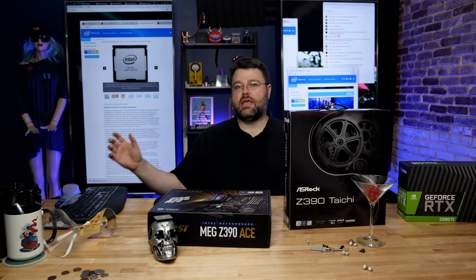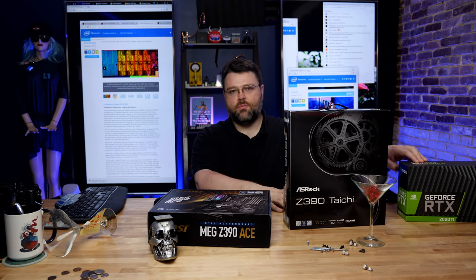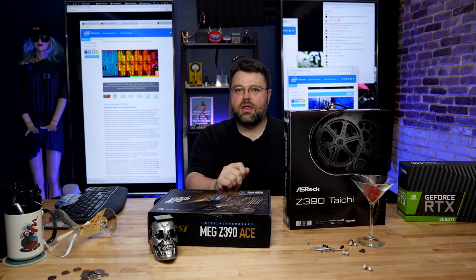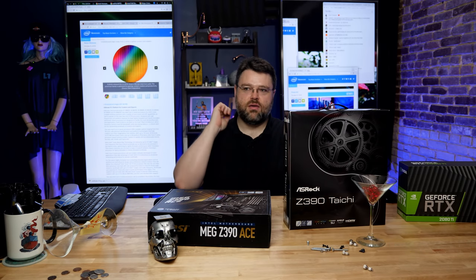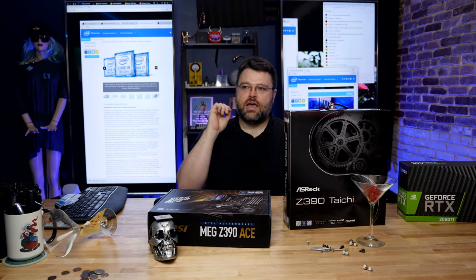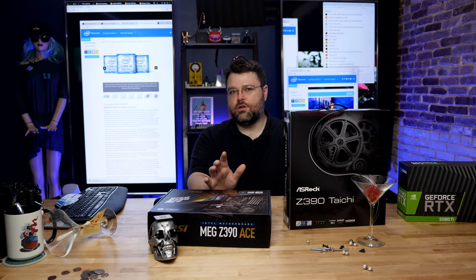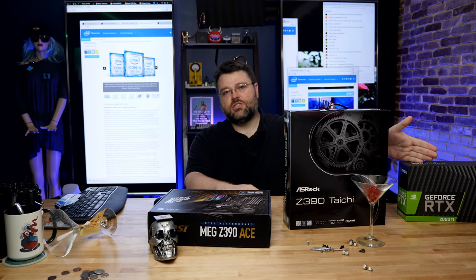It's really the high frame rate gaming. When you're talking about 4K gaming, the graphics card really becomes the bottleneck. It's a game of latencies. So if we play a game where I throw something at you and you throw something at me, back to me as fast as you possibly can, we could do it so fast that the physical motion of us throwing it is the bottleneck of how many times per second you can do that. And so when we're talking about 1080p gaming, the graphics card spends so little time processing that frame